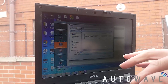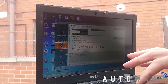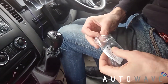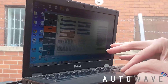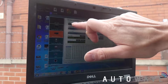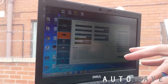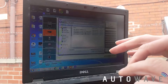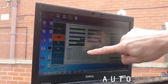I save the generated key file. Successfully generated. Now I go to Read/Write Key. I take my Autowave key, insert it into the device, and press Read. Looking at the screen, this is a brand new key — it has no SSID and no position has been allocated. That's fine. I press Open, press OK, select the key file we just generated, and it automatically writes the data onto the key.